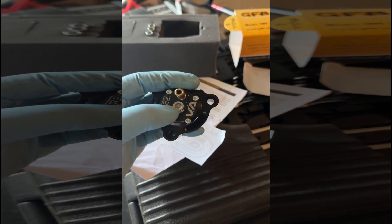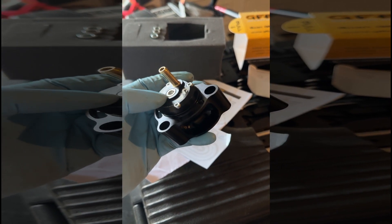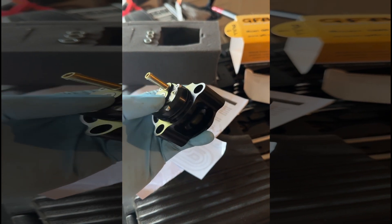This is literally a plug and play. You have your window right here for the blow-off valve, ports one and two right here, and then you have your spring adjuster to dictate how much or how little of a blow-off sound you get. If you like that reverberating sound from your blow-off valve, you can tighten this screw down.